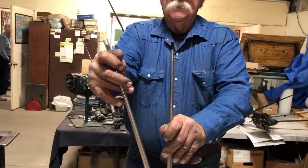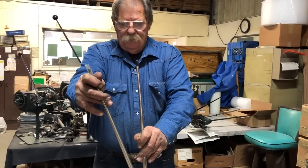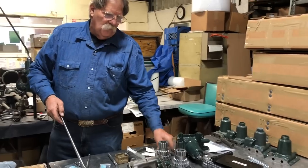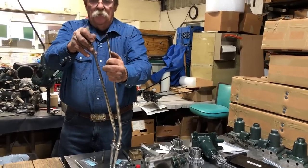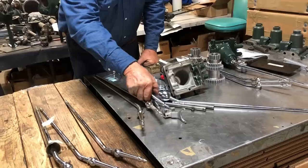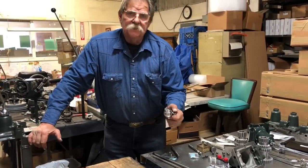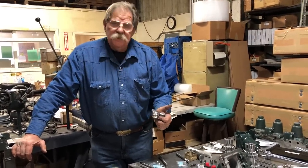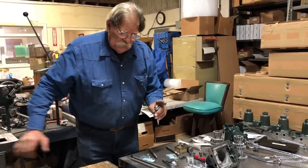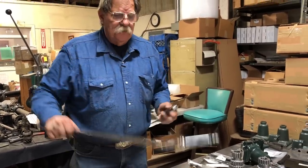You've got a couple of different options for sticks. We take original Model A sticks, repolish them, rebuild the balls, regrind them, and send them out to be nickel chromed. There are also two different imported aftermarket sticks — one is threaded together up top, the other is welded on top. In our situation we went with the style that was welded on top and actually send them out here in the U.S. to be re-welded. Out of 21 years, the last eight years I've used these sticks and I have never had one break.